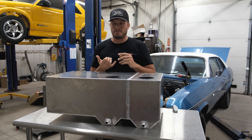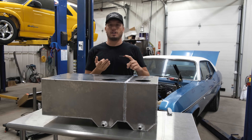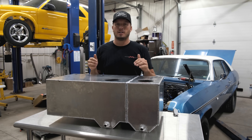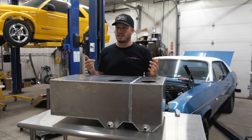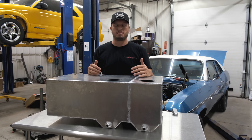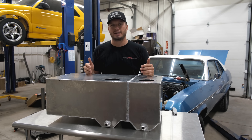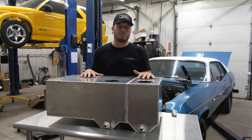There's always a lot of talk about fuel pump inlet size and feed line and return line and all that stuff, but one thing that a lot of people look past and forget completely is the fuel vent size. We just got off race week and I saw a lot of this. It's just something that's never covered, very seldom talked about, and it can cause some of the most distress and problems in your fuel system design — and it's actually a cause for a lot of fuel pump failures.